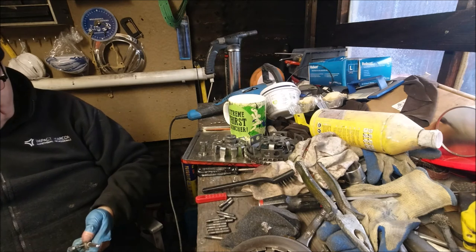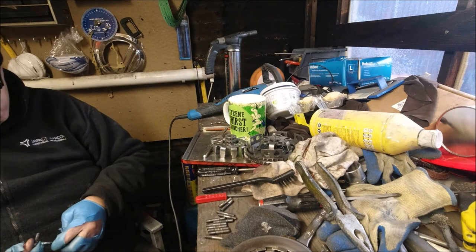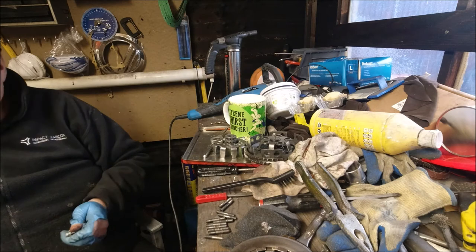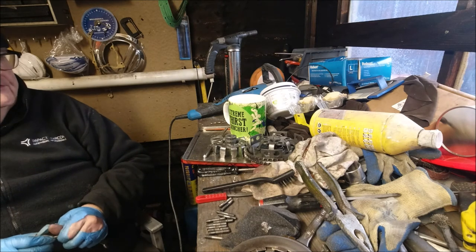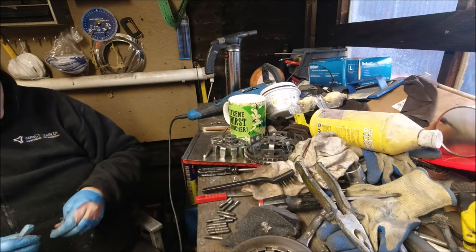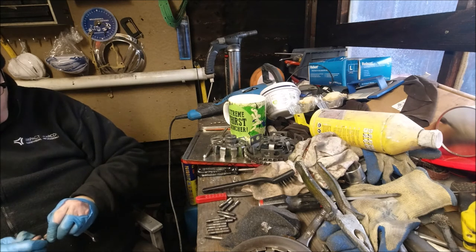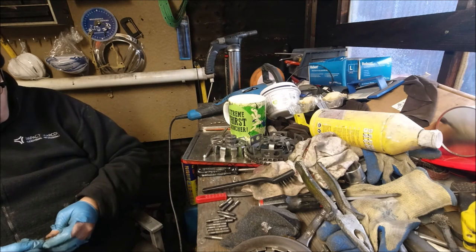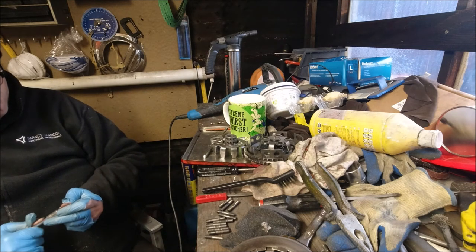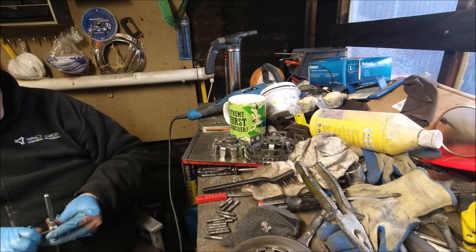And obviously on the running, it's a bit weird that it got the score mark and it had not been hitting anything, not touched any of what they normally do. They just touch on the kickstart shaft, rub against that as they're going around, but you do normally hear a squeal. I mean, it was only right on the beveled edge, wasn't on the high spot, which is a bit weird, but it didn't stop the clutch working. So the clutch was working fine, it was just very hard to pull in, and now it's manageable.